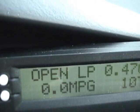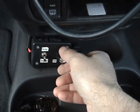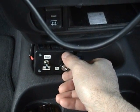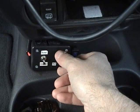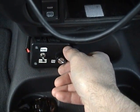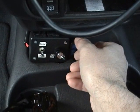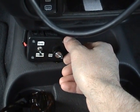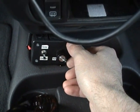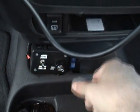So this tells me I can still control my air-fuel ratio even in open-loop mode. I've completely bypassed the O2 sensor and now I'm running through my MAP sensor, able to adjust the fuel mixture right here with this knob. We're going to go fill up at the gas station we always use, do a run, and check our mileage on this experiment.